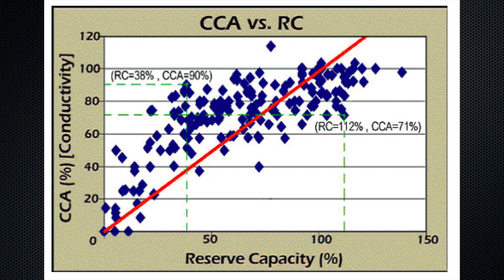I tested it at 80 amps and it passed, but it failed at 300 amps. Now is that a valid test? My garage is not a heated garage so we're not at 20 degrees C, and I guessed cold cranking amps at 600. If I guessed a little high, the numbers come out a little lower, so I'm not completely certain this test represents a fail in my situation. This battery is not being used as a starter motor — if it were, it would be a clear fail. But it's being used for reserve, and reserve is the holy grail of battery testing. There's a plot showing reserve against conductance with the new battery testers and it's more of a scattergram — not clearly a linear association — so I'm reluctant to call this one a fail. My conclusion is that this battery is on probation. It hasn't been cut from the team yet. We're going to retest in a few months, and I think it's on its way out in the next year or two, but I'm not going to toss it right now.